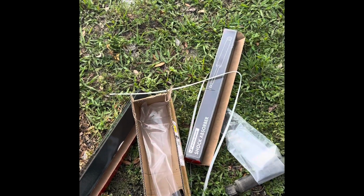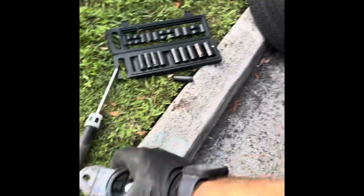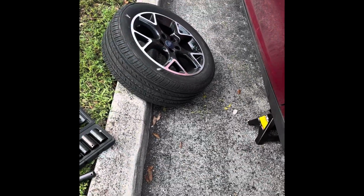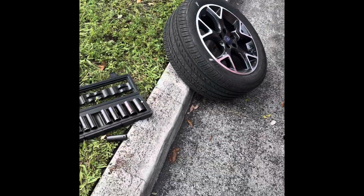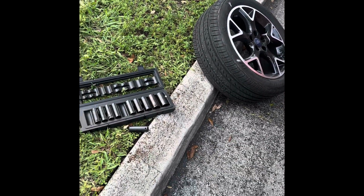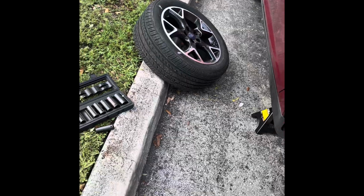So, well, good luck, and remember to put something on the wheel on the front to prevent the car from going forward. Even though the car is held by the transmission, you never know when the transmission might let go and let the car go forward. So having that little extra block is safety for the car.